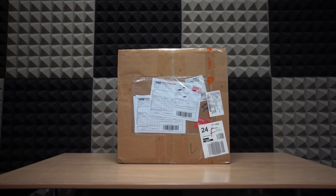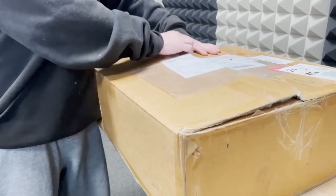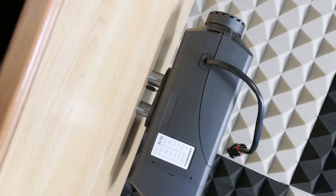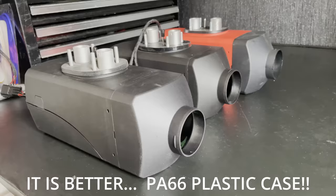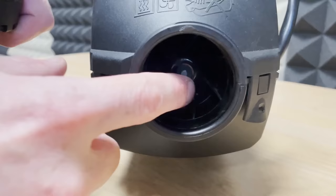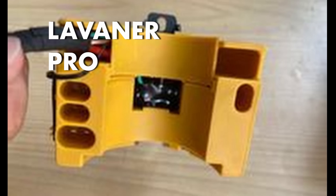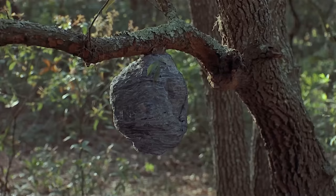Next is a massive step up in general quality — the Levana Pro original version, not the Pro Max which we'll show you soon. If you are looking for a decent quality, easy to use Chinese diesel heater with second-to-none customer service and aftercare, this is probably the best option for you. The heater body is a very clean cast and nice and strong. The plastic outer case is much better quality — much thicker and more durable, much less flexible. This will stop rubbing on the fan if anything presses against it, as will the clips and better quality end cap.